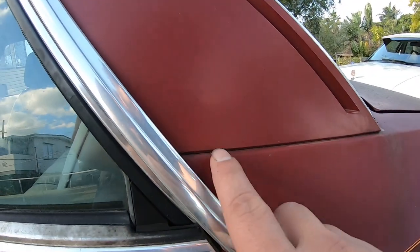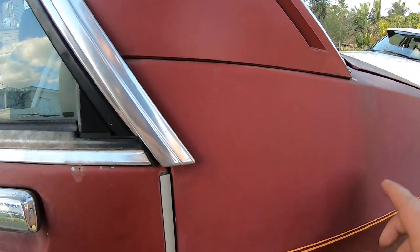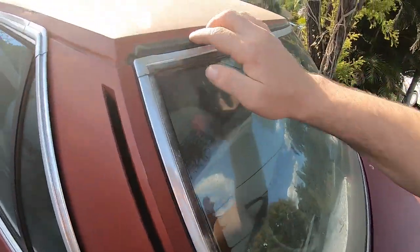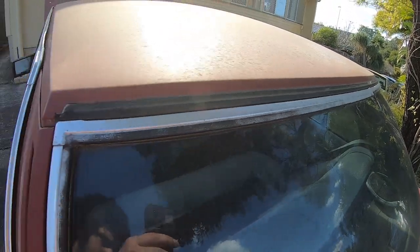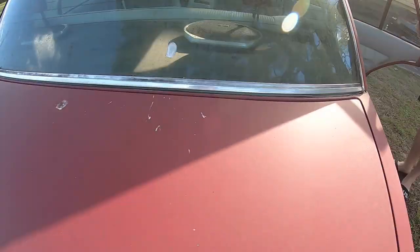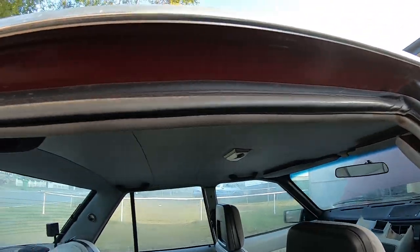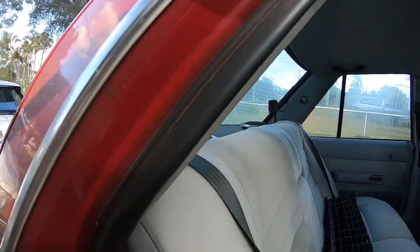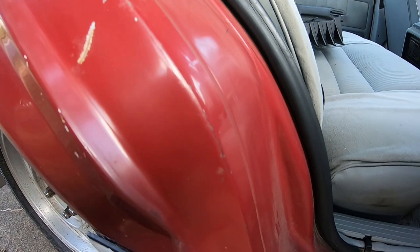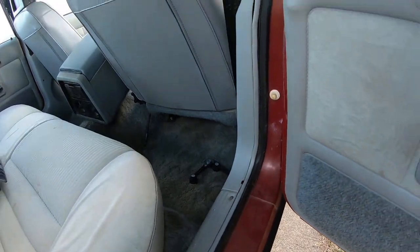Down on this joint, in around the back here, they can go. This is a really bad area on XFs — part of the reason I don't like them. I'm not sure what happened with the way they were welded, but they go right here, all around the back, on both sides — that's the top, under the rubber, all the way along, both pillars outside. Check all the way around guys, all the folds — anything into these triple layers of steel where it's folded up is tricky. It's structural, so you really want to check those structural areas out.